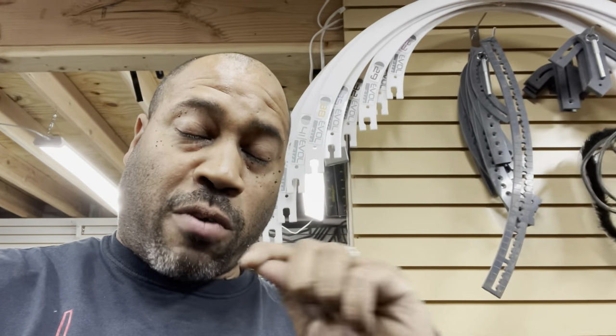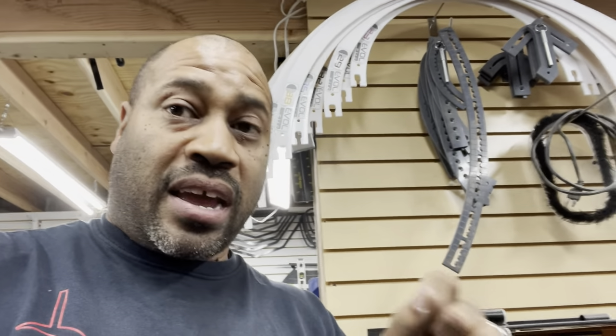There's nothing wrong with using a handheld crimper. The Klein one is probably the most popular. As long as you take your time, press in the middle of the connector right where that seam is — or use a seamless connector — and get a nice tight hug all the way around, then drop a bit of solder on top, you're good to go.